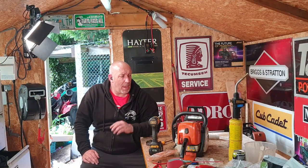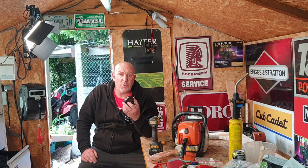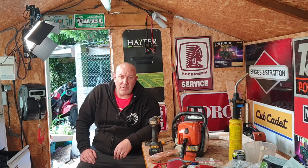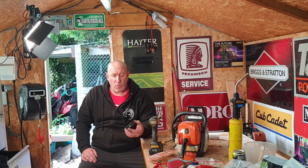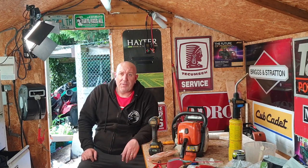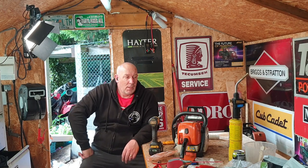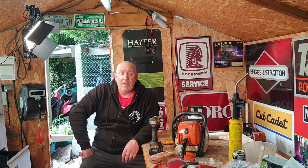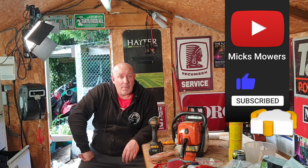So there you go - one MS390 now done. Now the clutch drum was slightly different to what I ordered for some reason, however he can just buy a new chain that fits it and he'll be good to go. It's got a new clutch drum in there with a sprocket built in and a set of needle bearings. It doesn't take long to do. The most crucial part is to make sure your worm gear lines up with the clutch drum. And don't forget - when you put the piston stop rope in, make sure you do it when the piston is coming back up so the rope doesn't go down through the exhaust port. Quick and easy - if I can do it, you can do it. Hit the subscribe button, whack the bell, set notifications to all. Much more importantly, take it easy.